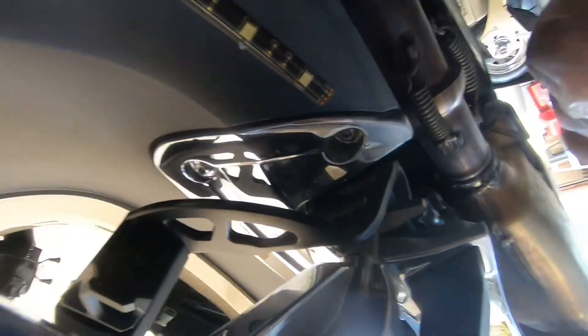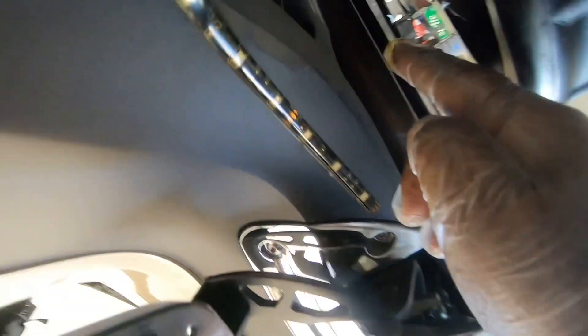For those of you that may not know, there is a plug right here where my finger is — I don't know if you'll be able to see it. That's the transmission side plug; you have to take that plug out. But I take the oil side off first and let most of it drain off, and then I come to this side. You have to stuff some paper towels there because the oil, once it comes out and gets short of coming out, some of it will run all down throughout your bike, and the paper towels help to absorb it.